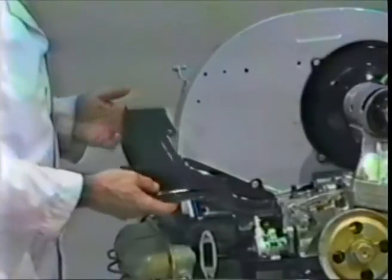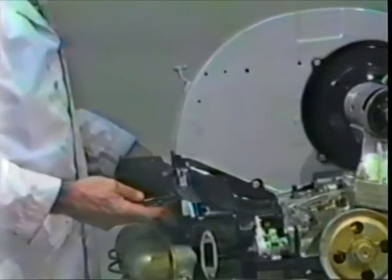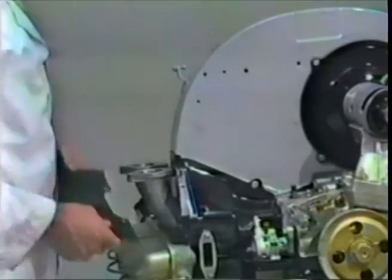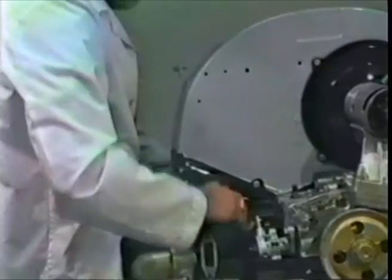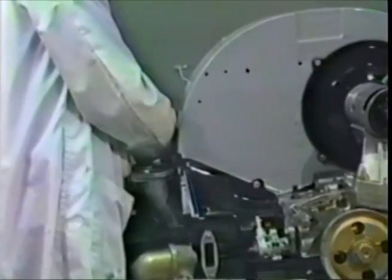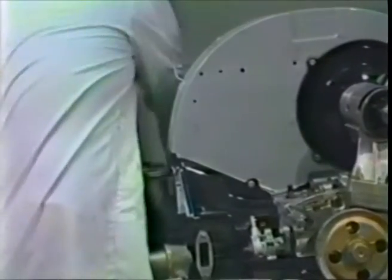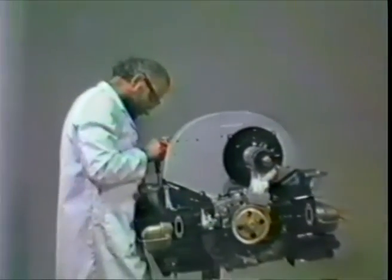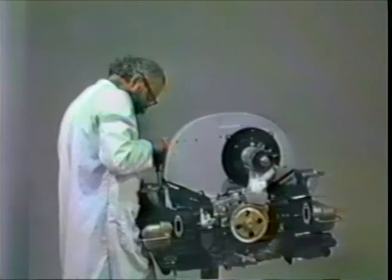Now the side horizontal shroud with the curve is always at the front, kind of narrower at the front, so you always put this on. This is the left-hand side one. The other, of course, would be the right-hand side one. And here's where those self-tapping screws really do play a role. You squeeze everything in, and here's where three hands really play a role too. You try and get the holes to line up. Usually that means putting the screwdriver through the spark plug hole, prying one out as you push the other one in, and then trying to get things lined up enough and hold it to where the self-tapping screw can actually do its job.